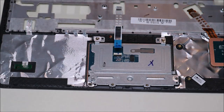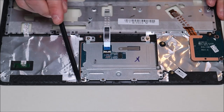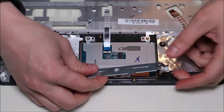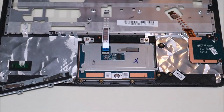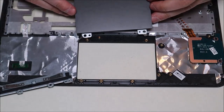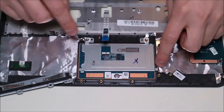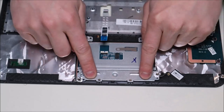To get the rest of the touchpad up, you'll see bright silver stickers holding it down in several spots — you have to fight those stickers. Peel it up here and it comes loose. You'll see your mouse click buttons, the click feature, and the rest of your touchpad. If you're replacing this, you can rip it up — it's not going to hurt anything. To put it back, set it into place, bring the shield back over, get it under the clip, set it down, make sure the stickers are out of the way and screw holes are available, then put the screws back in.